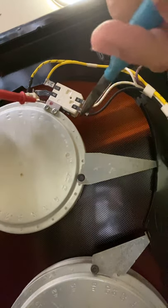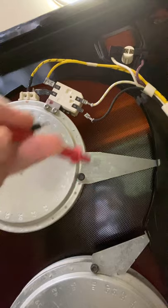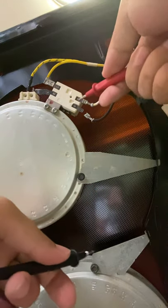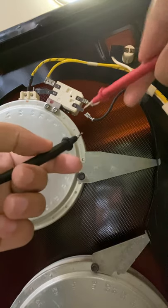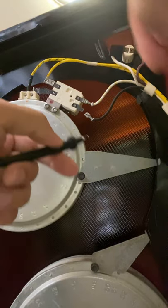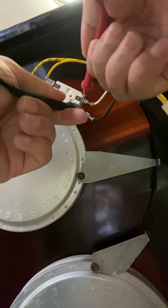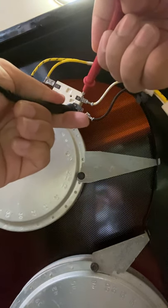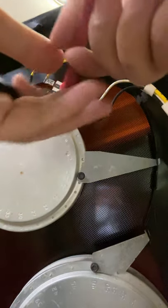If I move over and test this one, this is a good switch. These are the two small terminals leading to the hot surface light. This should be normally open, just like that other one should have been. When I test this, I get nothing - no sound, open load. That's what it should be.